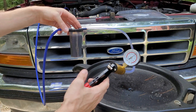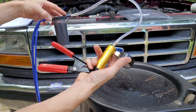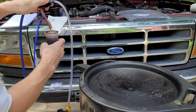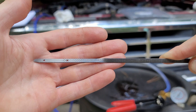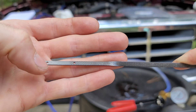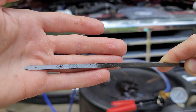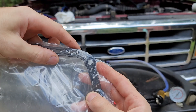Start pulling a vacuum. Once you get near the top, you're going to want to break the seal and let the pressure out, because especially on these cheap pumps you do not want to be sucking fluids into the pump itself — that will destroy the O-rings. Once you've got a full cup, dump it into your receptacle. Remember, if you're trying to reuse this fluid, keep it clean. Once you've drained enough, pull the hose out, put the dipstick in, and you want the fluid to be down around the bottom hole or lower — the top of the pan is around the bottom of that hatch area, so as long as the fluid is lower than that, it won't come pouring out when you drop the pan.